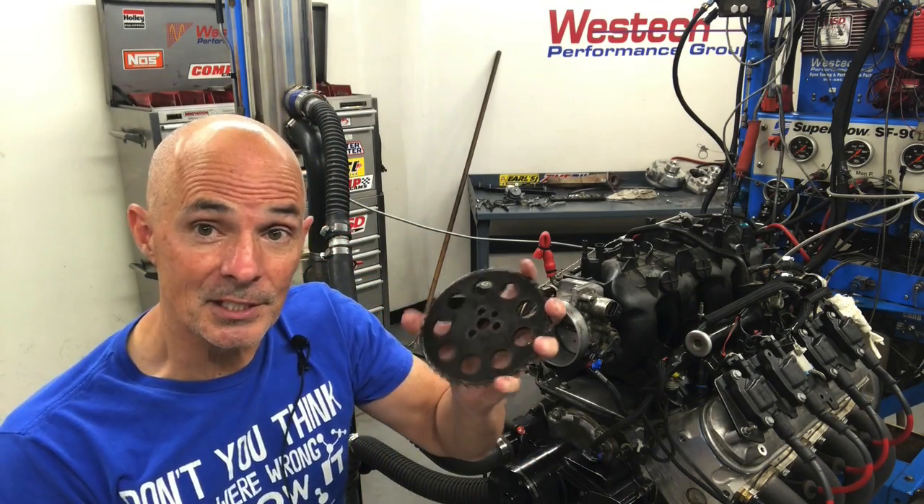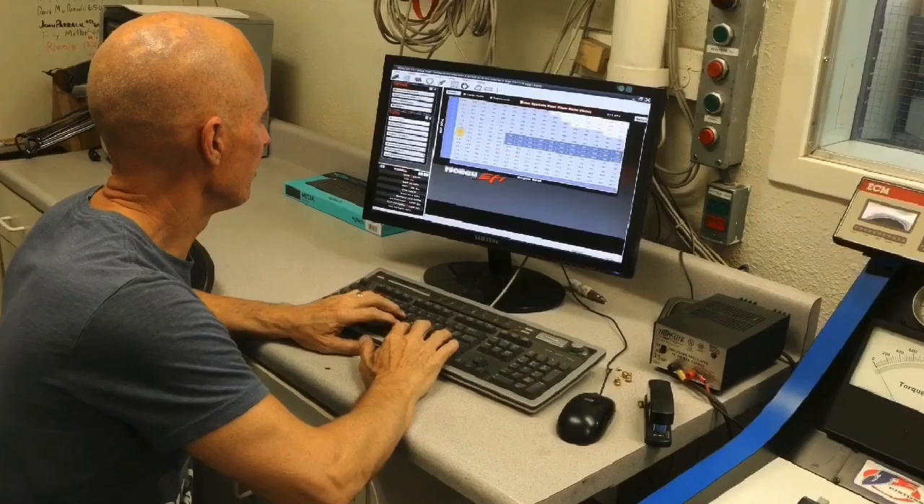This is a gen 3 motor and it's important to note that the factory LS9 cam is a gen 4 version — it has no cam sensor on the back of the cam. So this would be much more difficult to try to make work with a factory ECU. You could put a 1x cam gear, which will have a provision for a front mounted cam sensor. Since we always use the Holley HP management system, we can put whatever configuration we want, which makes life easy for us. But if you're using the factory ECU, I want the tuners out there to let me know in the comments — would this work? If we're adjusting the cam gear, is it going to throw the cam signal off? Is there a way to offset that?